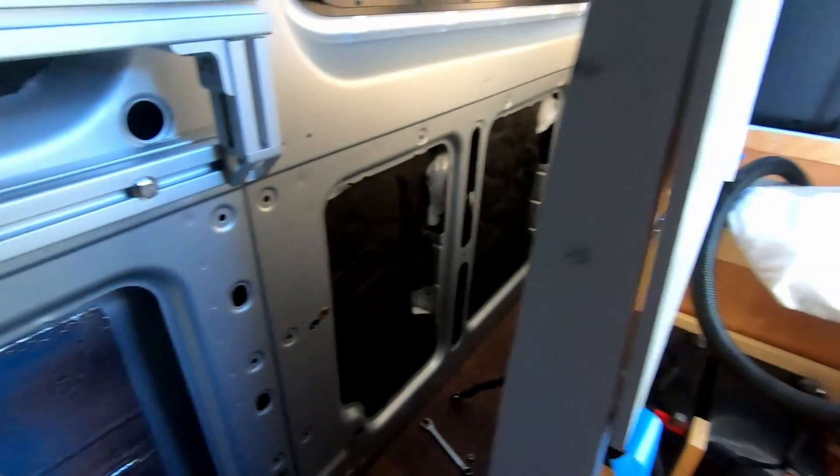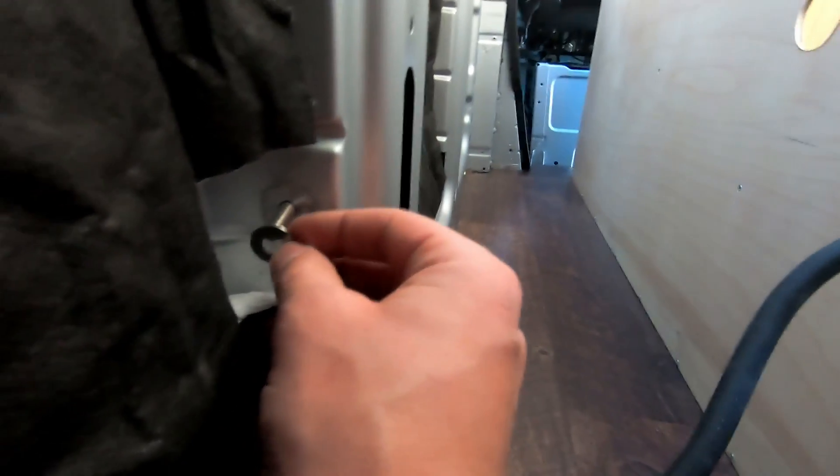One of the most important safety requirements for electrical connections is your ground terminal. You need to make sure to ground the negative post of your battery to the chassis of your van. To make your chassis ground you need to drill a hole in the chassis. I drilled a hole directly behind where my bench seat is sitting and made a 5/16-18 hole for a 5/16-18 bolt. I put a washer on either side, and you want to make sure to sand down the surfaces that are going to be in contact with the electricity. I used a little Dremel to sand down the metal — you can see how shiny it is, just bare steel, which is exactly what you want for the best connection with the chassis. Then you take your ground wire and simply connect it to the bolt.